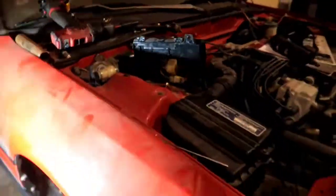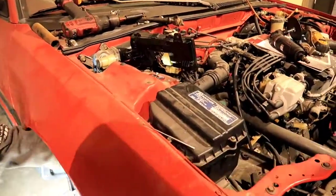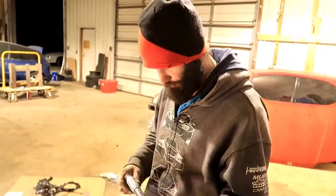Alright. What are those torque to? Alright guys, you're gonna wanna set these upper control arm bolts to 47 foot-pounds. This out of the way here. And just get that torqued. Go one pass. Alright. I'm going to do that guy right there, if I can get to it with a reasonable angle.